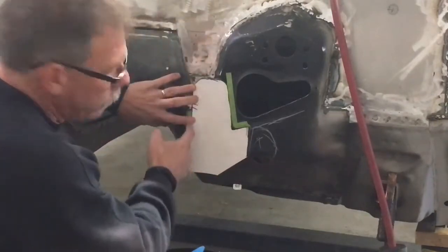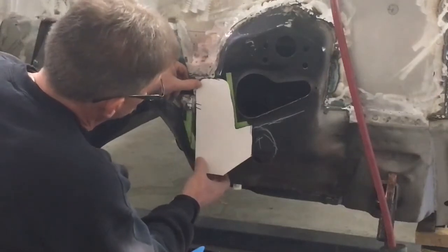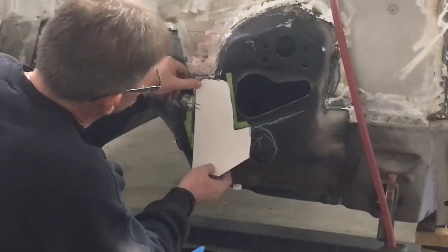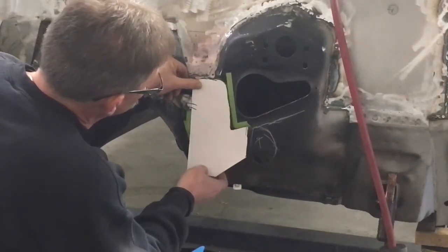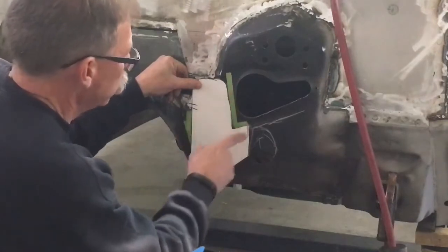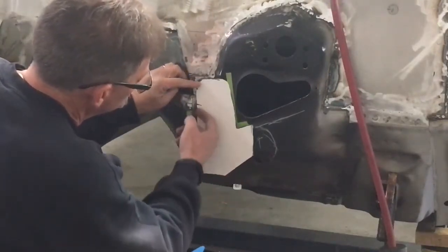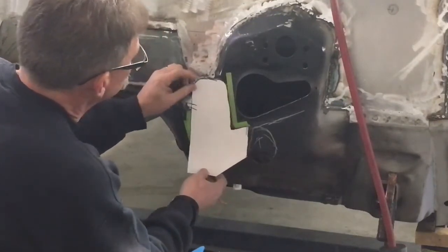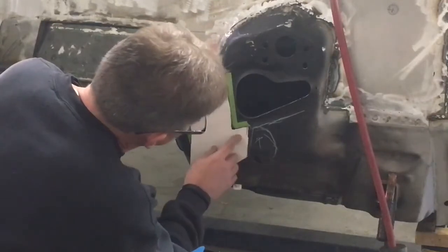Again, I have not messed with this edge at all, even though I know this is going to be closer down here than it is up here on this line that I drew. This is how I keep realigning everything until I get some other sides where I'm happy with them. Once I get these sides where I'm happy, I'll make some new reference marks, and then I can come back in and trim the pattern for that quarter or 3/8 of an inch that I need to take off. But for now, it's just reference.